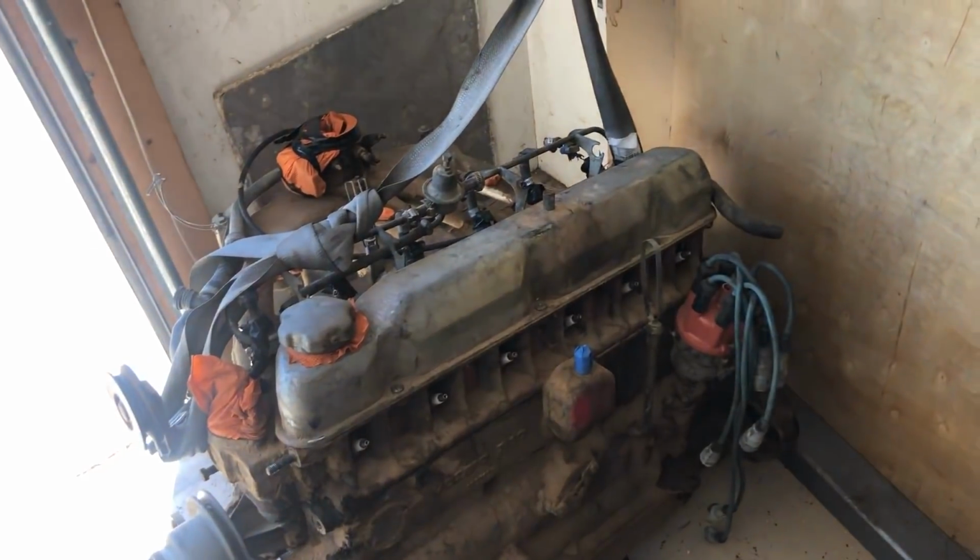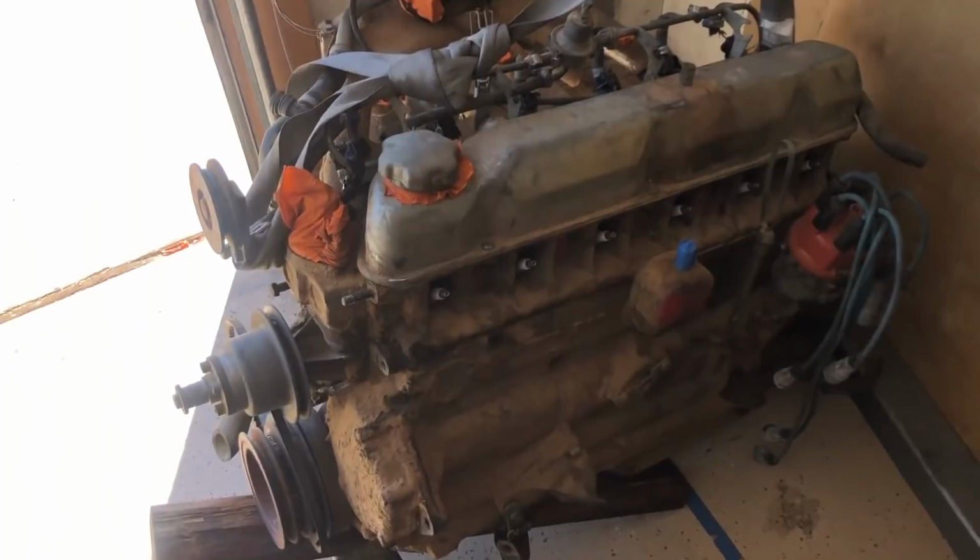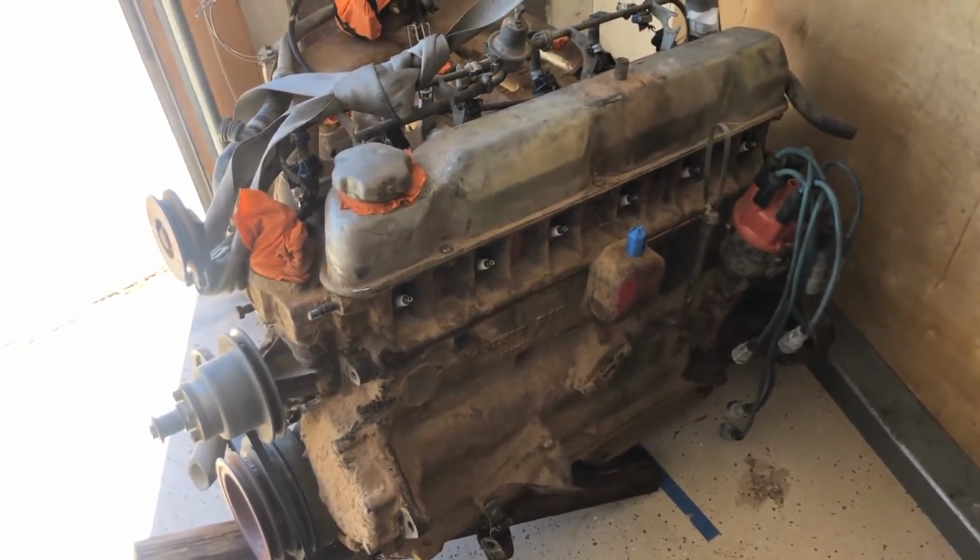While I wait for my sunscreen to dry, I shall remove the spark plugs, put a little MMO in there, a little Marvel Mystery Oil, just to keep water from getting on those rings should there be a breach in the head gasket, which we definitely reused from yesterday.